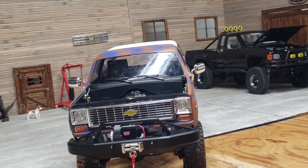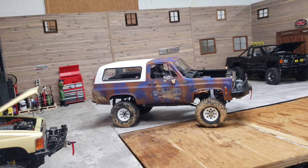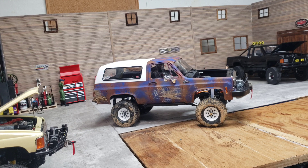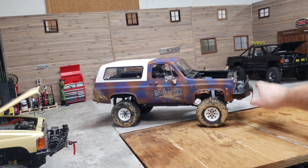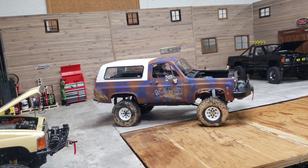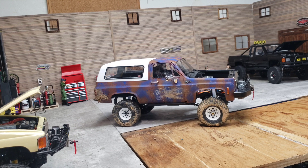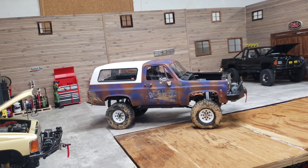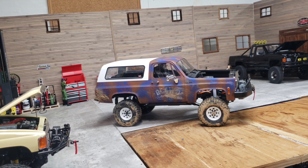Okay guys, we're back. This is with the bumper mounted using the Marlin-style bumper mount. You can see it moves it up and gives you better clearance here. If you're actually off-roading, that gives you a better approach angle - though you're not going to have a great approach angle with a big winch bumper hanging out there either way. That's why most guys you see rock crawling are out with pipe bumpers, because they give you better clearance and better departure and approach angles.